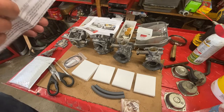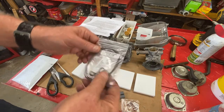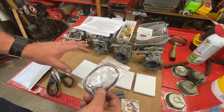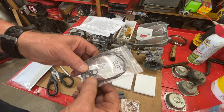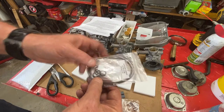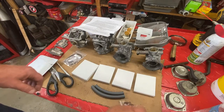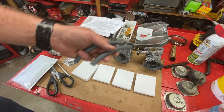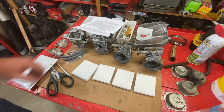There are some instructions we'll go over in a minute. This is very similar to what you find in the kits for the Valkyrie from Red Eye Technical. So let's take a look at what we've got. These are carb bowl gaskets — they're not formed like you typically see in a float bowl gasket shape; you just kind of put them in. There are also some O-rings, and I'm pretty sure these are the joint O-rings. We may use these and we may not. Then we've got a couple pieces of fuel line which go off the fuel tees — between the fuel tee and one rack of carbs, and between the other one. That tee is where the fuel pump inlet goes. And some spring clamps for the lines. Pretty nice.